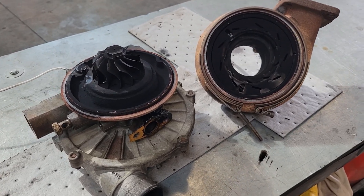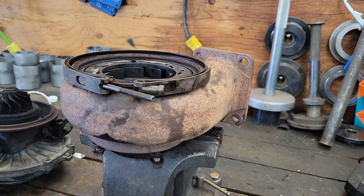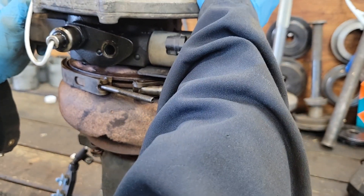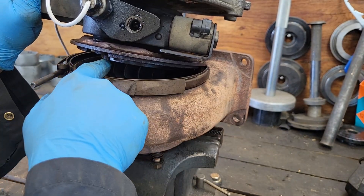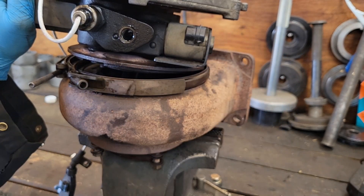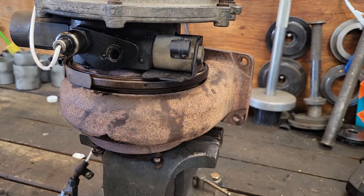Once I get this back from the turbo shop I'll get them to check out the whole thing regardless, and I'll let you know what it costs to repair versus a new turbo — I can guarantee we're going to save a bunch of money. So just take your time, eyeball everything as you go back in, and drop it on. It might take a little moving around but you'll feel it drop into place. Eyeball the actuator first, get that roughly in the right spot, and once you get that in you can give it a little twist and it'll fall onto the dowel. Once you feel it drop down, put your clamp back on and start the reassembly process.